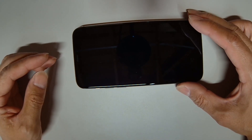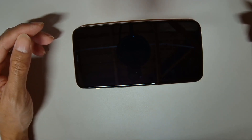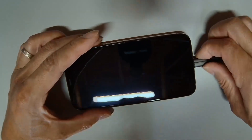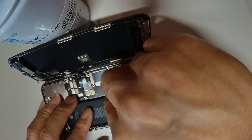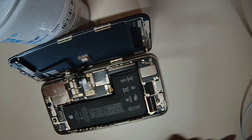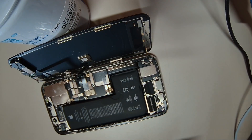What's up guys, today we have an iPhone 11 Pro that had a no charge issue. The first thing we need to do is plug in the charging port and see what we get. When we plug in the charge port it's showing 0.2 to 0.3 amps, so it looks like this phone is not actually having a charging issue. Let's go ahead and plug in the power supply and see what the boot sequence is.